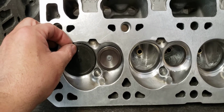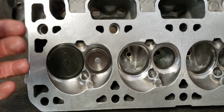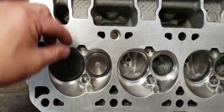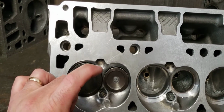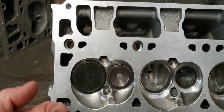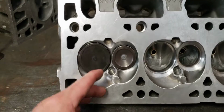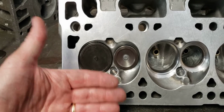Now, if you will remember in the earlier video, I said how heavy and hard to move air really is. Now, there's again no real momentum, especially during the overlap, because the piston is still traveling up towards top dead center. It hasn't reversed direction yet to come back down. That's why this valve, if you have proper overlap, opens some degrees before top dead center, BTDC.